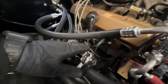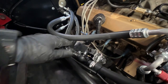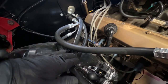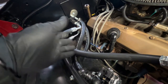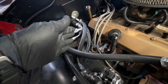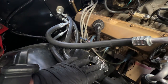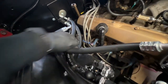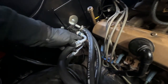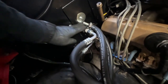Here's the heater control valve. This is what controls the heat inside of the car. It's run by wires — there are no cables on these new systems. They're just like modern cars. They use servo motors to turn the different flappers for the defrost, dash, or floor ducting, and it controls the heater valve here as well. All the hoses are replaced with new — these are heater hoses, and these are the custom-made air conditioning lines that I make myself and install.